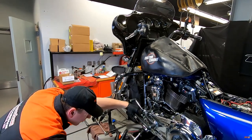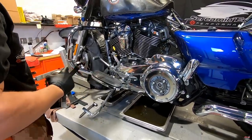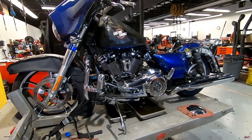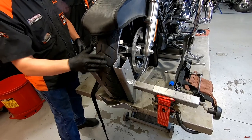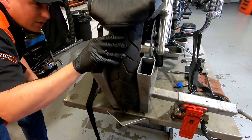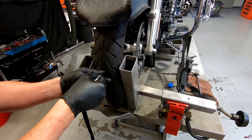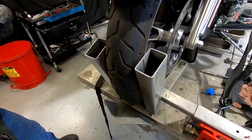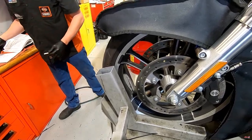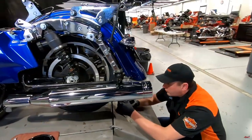On some models you would need to lube the clutch cable and throttle cables, but this motorcycle has a hydraulic clutch and electronic throttle. This model is a 2017, so the tires' date codes are going to be absolutely fine — the oldest they could be is a 2016 date code. We're inspecting the tire tread depth in a few different places, and also checking for signs of uneven wear. It's surprising how much more quickly tires wear unevenly when tire pressure is improperly set.